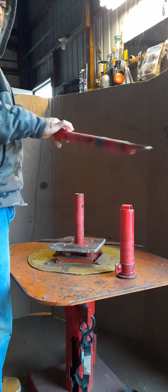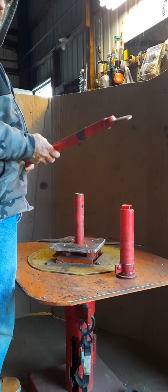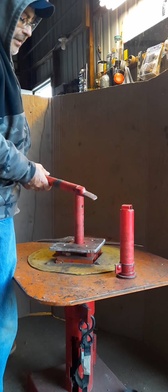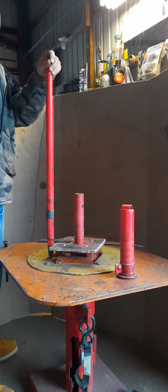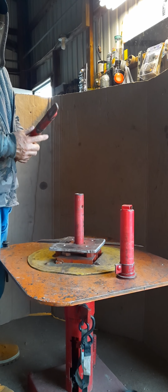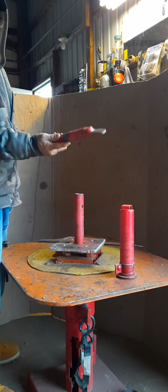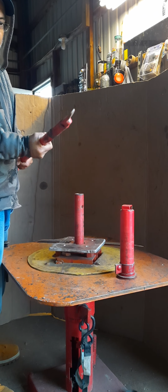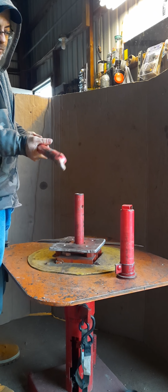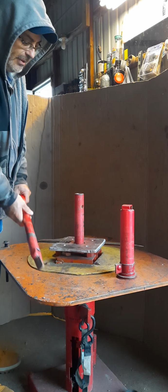You probably recognize this. This came from the Harbor Freight, used to put on tires and take off tires. You'll see a video that he said, oh, he used it so much he abused it. Well, if he was a little bit smarter, he would have cut it open and stuck a steel rod in there. And then JB welded shut or welded back shut, and that way it won't break, it won't bend. It'll be heavier, but it stays in shape. Do that the first time.